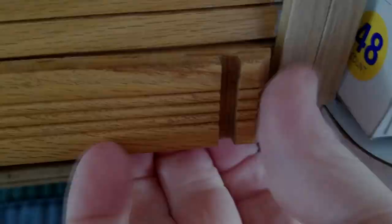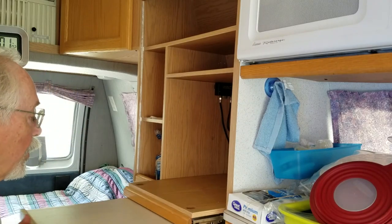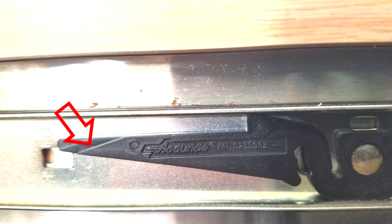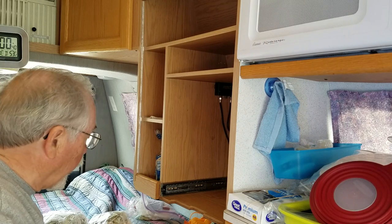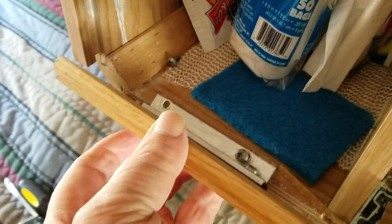To remove the door you have to take the bottom out — there are two slide-outs. Down in the right-hand corner you'll see the metal slides; inside there is a tab on each side. Mine had an engraving saying to push in one direction, but I found it came loose if I pushed one up and the other down. Just push on them and pull until it comes loose — there's one extra bump, then it comes out. There's also a block on the left-hand side under the little cabinets; stick your head inside and you'll see a strip of metal with two screws. Remove those two screws and that wood block comes out too.